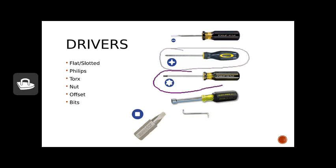More commonly used is a Torx bit, and they're more common for really one key reason: the star shape of the Torx bit makes it much more difficult to strip these screw heads out than Phillips or flat head. The Phillips head strips out very easily, and the flat head can be hard to keep in place when applying torque. The Torx head really shines there. I tell students at LSU — one of the first things you can do to help your sanity is to convert everything in your shop, especially woodworking situations, to Torx bits and Torx headed screws.